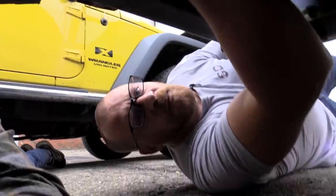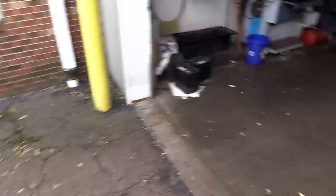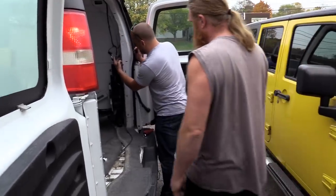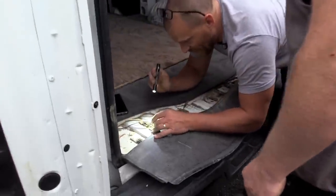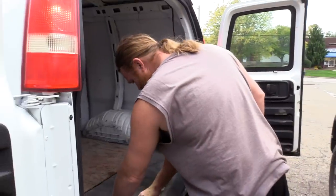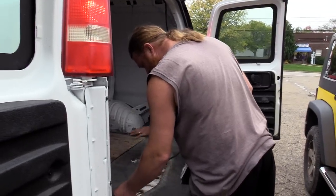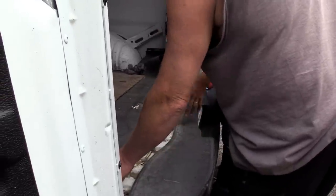We're just going to tell him exactly what we said earlier. Tanner, real quick - we didn't see anything inside, everything looked okay. This green wire is the left turn signal and it does run down underneath. We had these wires right here laying inside this clip, except none of those are the left turn signal. So that's your left turn signal and it's good from there down. Just so you're aware - if it comes back with a blown fuse, this is the leg that you're worried about. And the turn signal is the brake.